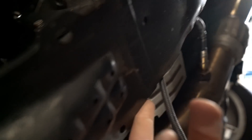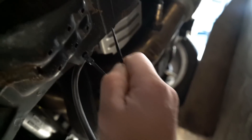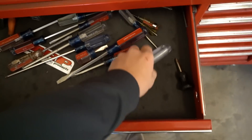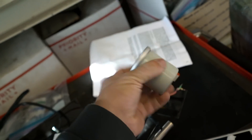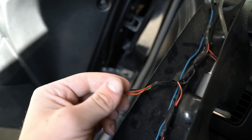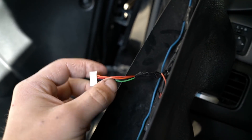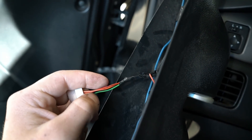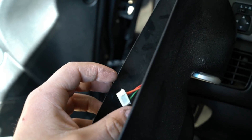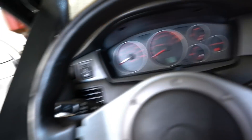For the sensor routing, I'm just going to run it on the top side and straight up through there to the wire connecting to the gauge. I'm going to zip tie the wire onto this crossbar so it doesn't fall down, drag on the ground, and get ripped up. We got that sensor ran. Now I pulled out my old AFR gauge and there's wiring we can tap into, which makes this super easy. I'm just going to cut the wiring connector off, use the red and black for power and ground, connect it to my new AEM gauge, and then run an extension wire from the blue wire all the way to the glove box for the serial-to-USB.